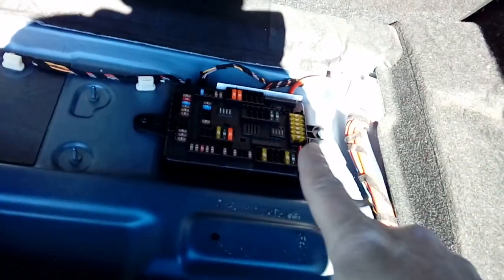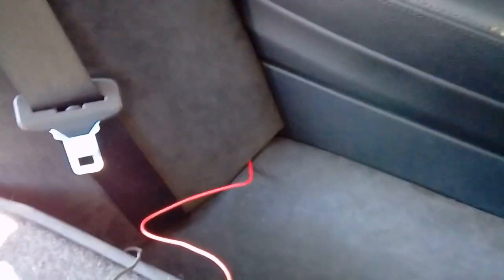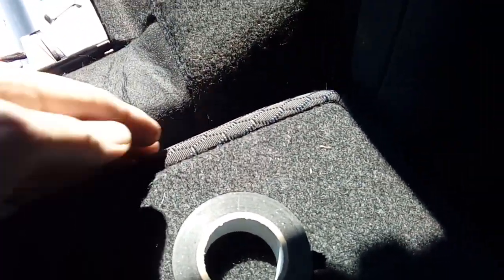Your fuse box is in the rear of the car under the boot floor. After emptying the boot, lift the boot floor and there's your fuse box. We've tucked the power cable — the red cable — down the edge inside the vehicle, which can be quite tricky. Then feed your power cable up and under, pop it out, and connect it to the one coming from the front. Obviously we've had to extend it to get it along to the fuse box.